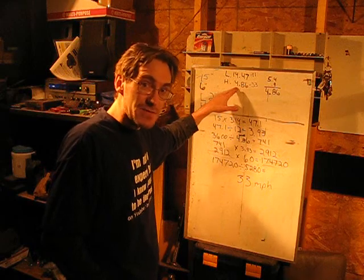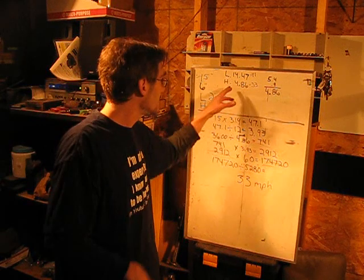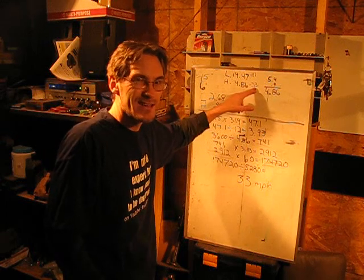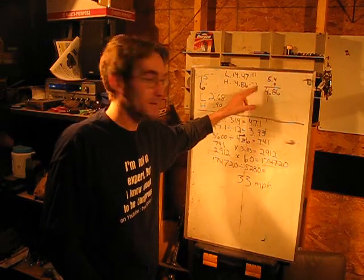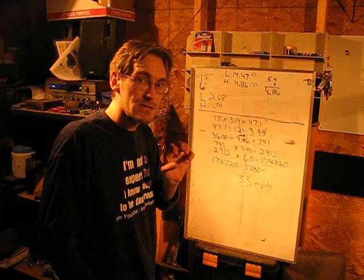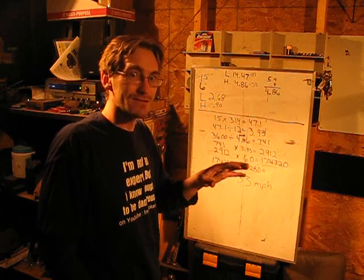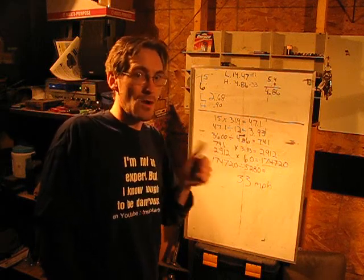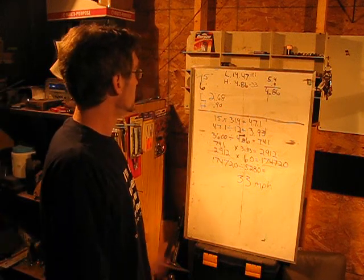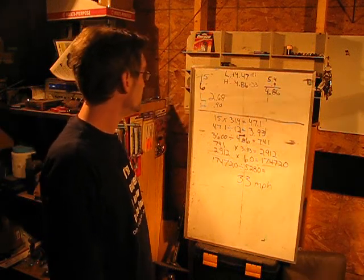And then once she gets up to maximum speed, the torque converter changes and shifts. It alternates its ratio. I know that I'd be able to go 33 miles an hour on Allie's go-kart. That's why I didn't put a torque converter on that thing. This is why. A clutch and specific sprockets gives you a set speed and nothing over that. So that's why when it comes to my kids, they will always get just a clutch, not a torque converter. This is what you got right here. Good, some decent speed, decent power.